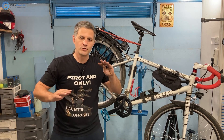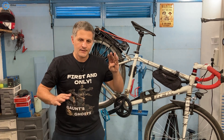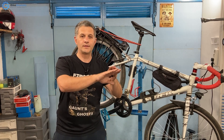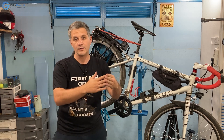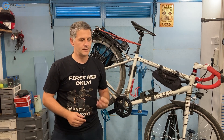The axle can get worn and may break when you push hard out of the saddle. When that happens, the leg you were pushing with will drop freely, you will suddenly lose pedal resistance, and your bike will swerve sharply in that direction. If you're riding into oncoming traffic, being overtaken, or near a cliff, you can get seriously hurt — and it's easy to prevent.